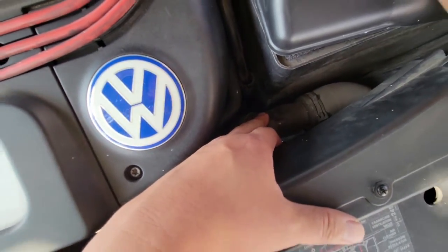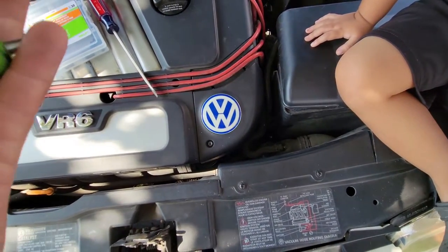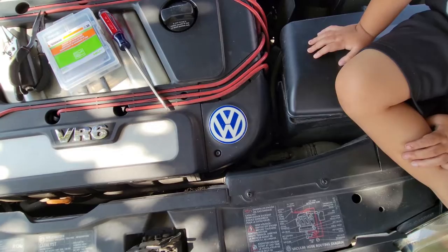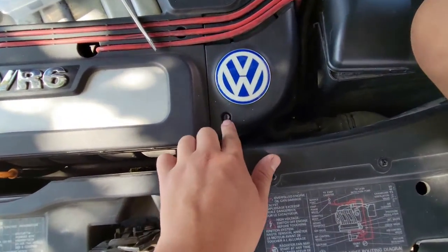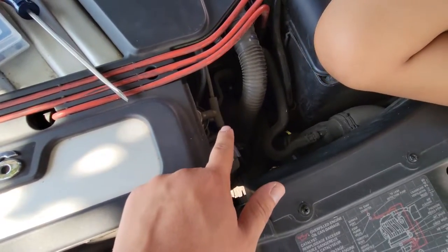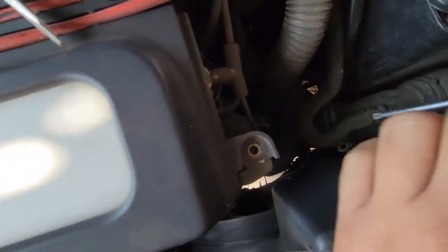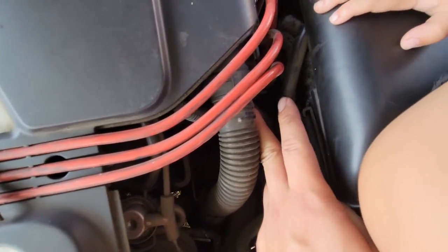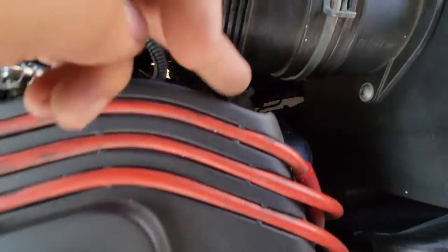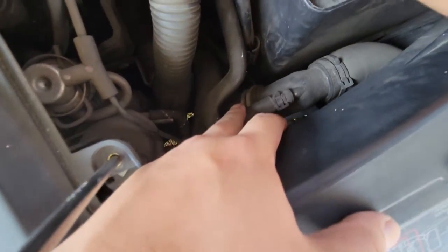To take off the engine cover I just need — it's a star bolt here. The engine cover piece is off now and I can see the hose more clearly. It kind of routes around here, goes all up here and into a metal tube bracket that runs along right here. I'm going to cap this part off first.